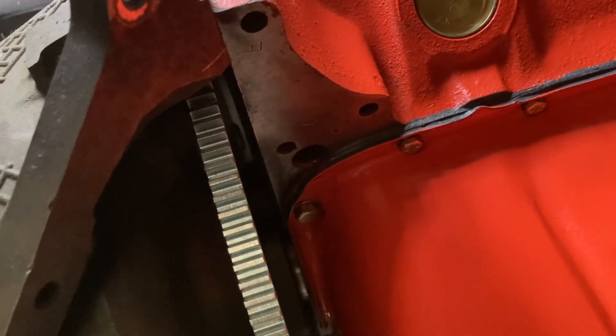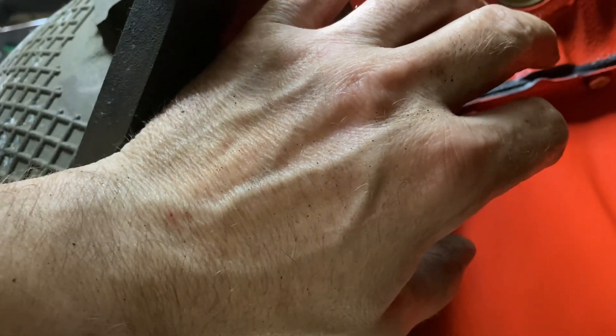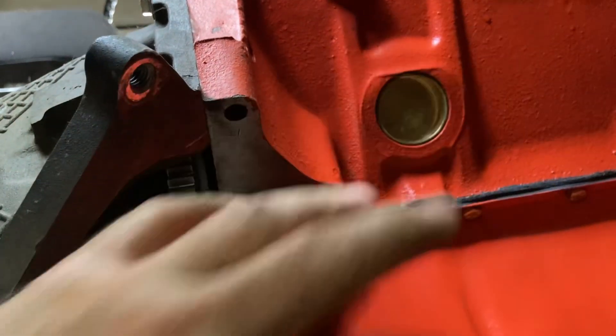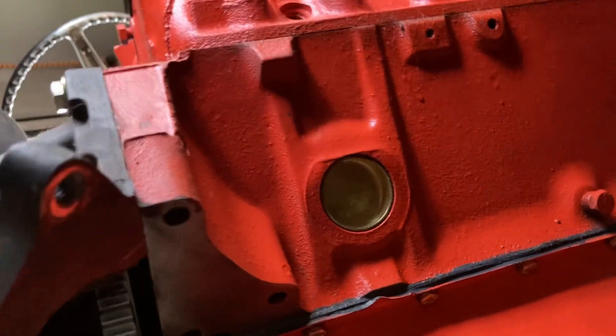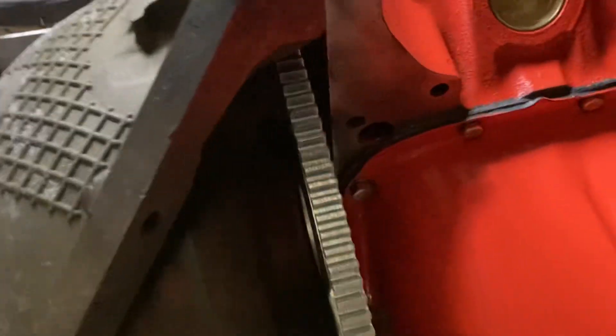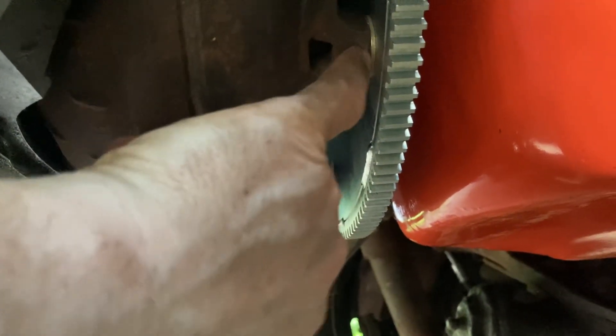I need to get another starter. They got some that they call lights or minis, where you can actually clock the solenoid so it's in a different spot — so if you have headers you have room for them. I actually like the exhaust manifolds better. I don't know why — I think they sound better. Performance-wise, I'm not too worried about it. I've got to finish the torque converter bolts. I've got my torque converter gap set. One washer is all I really need, so I'm going to do three more — maybe I'll find the bolts and do all six.